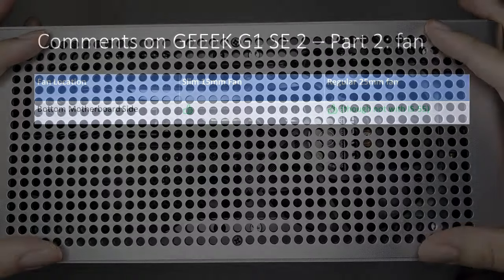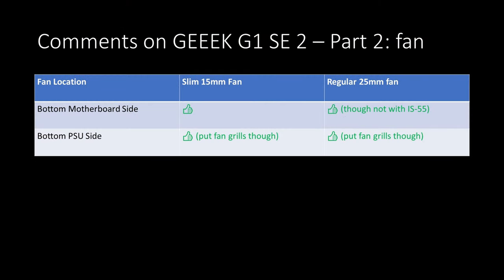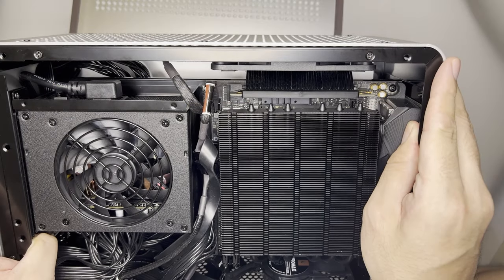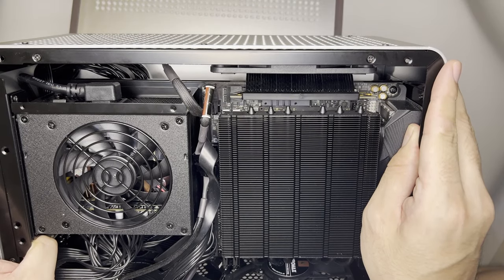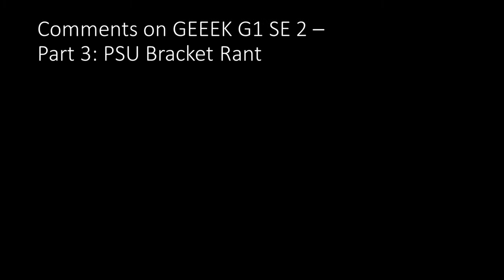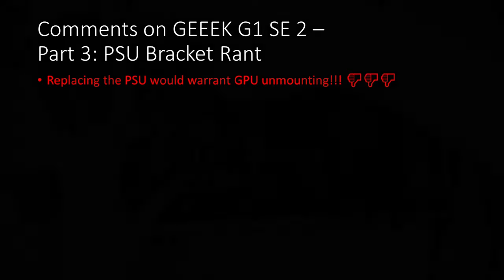The spec says it can fit a 320mm card and the Strix is 318.5mm — it doesn't fit by default. Even after removing the outer shell, the opening at the front was also inadequate. They built it for rigidity, so they should have just lowered the compatibility spec. This is over-promised and under-delivered. Another blocker for the Strix is the PSU extension cable — its location makes long GPUs difficult to install. Expect bending if you don't relocate the extension cable. As for fan compatibility, they said it accommodates four fans — two at the top and two at the bottom — but the bottom PSU side has fan grills that block PSU cables, and the top PSU side with the PCIe connector won't even fit a slim fan.